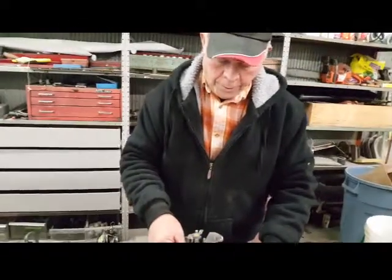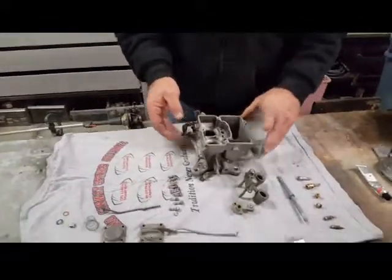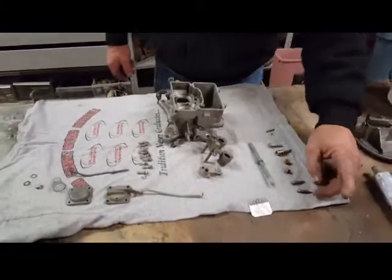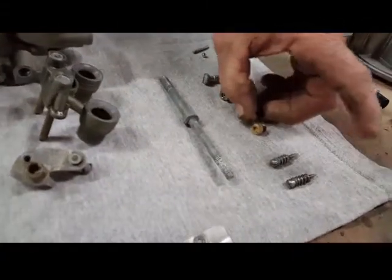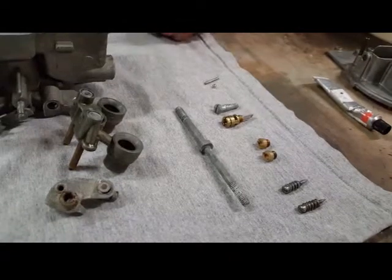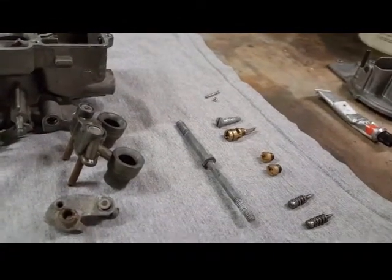So Terry's saying two barrel carburetor, which means light, maybe a 450 CFM. Two barrel, and this equates to two Venturis, right? Right. Two V. We got two air jets, two fuel jets. We have a singular seat because we've only got one float chamber. Right. So the seat goes with the float chambers.